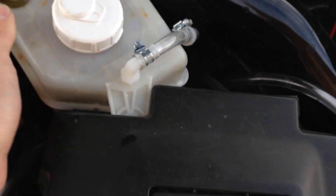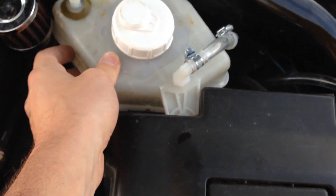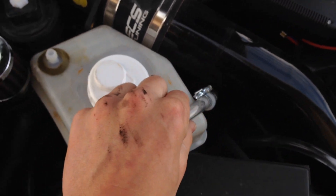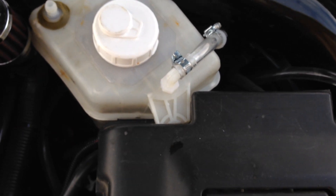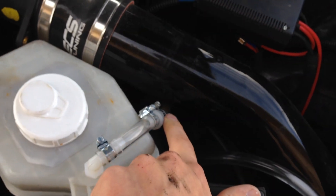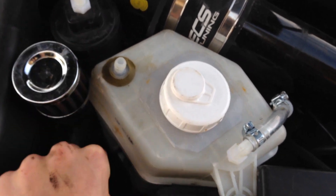You've got to be careful, because when you turn the system off, the electrolyte is very warm — pretty hot — along with all the engine heat. So this container, since the air in the top is hot, when it cools down it'll draw a vacuum. It'll draw a vacuum out of this hose here, which is the only way it can, and it'll draw whatever you have in the bubbler into the electrolyte reservoir. I had a problem with that — it came out one day and the reservoir was green. It had drawn all the antifreeze out of the bubbler into the reservoir, even though I had a one-way check valve. So to solve that, I put another one here, and the flow is this way — it can only flow this way.